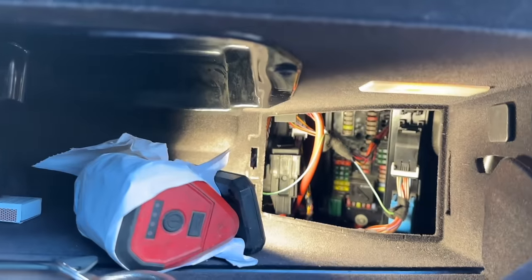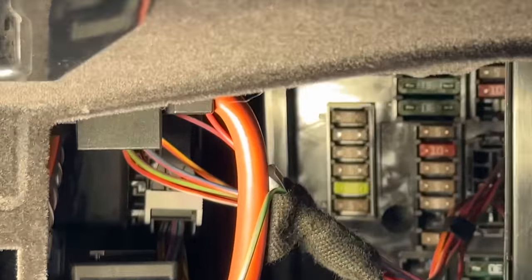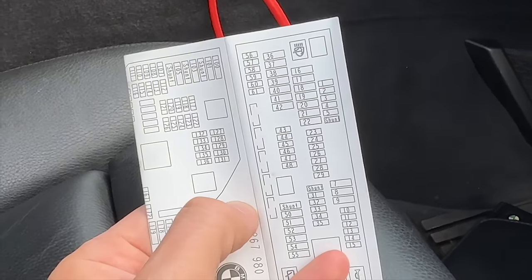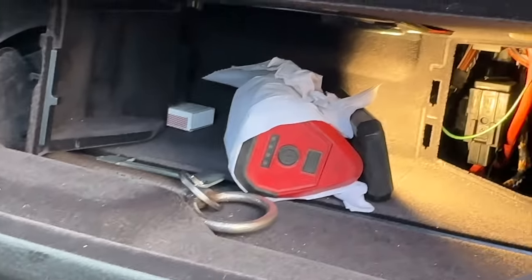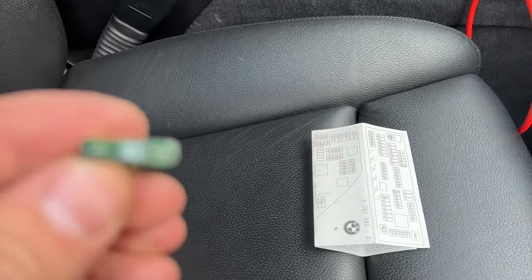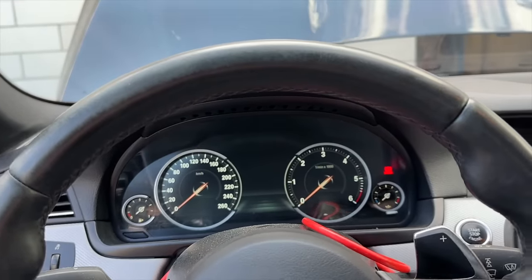It will be very hard to show you which one has to be deleted. It is in the frontal fuse box. But the easiest way to show that is just check the diagram, F21, and this is how it looks like. Just remove the proper fuse. And that will be the 30 ampere fuse. So it's not focused now, 30 amperes. Now let's start the car.